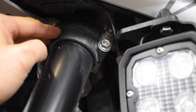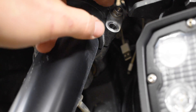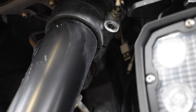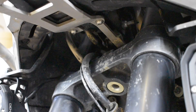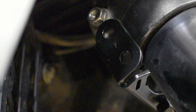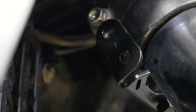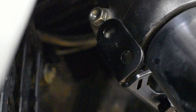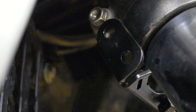Next, your lower fork tube clamp on both sides — you're going to remove the lower bolt and save it because you're going to reuse it. Once you remove your lower bolt on both sides, you're going to slide the bracket partially into place. Remove your upper bolt and slide it all the way into place, then put those bolts back in. Right here is where the middle slide lock bolt is going to go in. You want to put the bracket partially into place first before removing the top bolt. This is because the fit and finish is so tight that if you remove both bolts first, you're not going to be able to get the bracket on. So remove the bottom bolts, slip it on over, then remove the top bolt and that will allow you to slide it the rest of the way up.